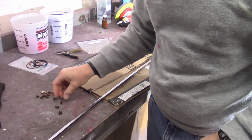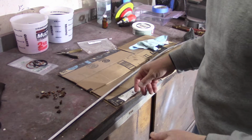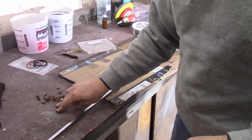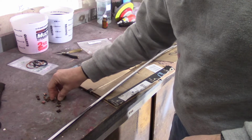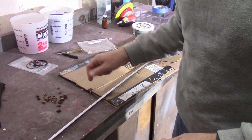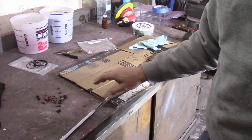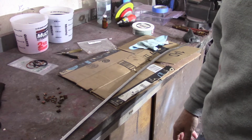You look at the workshop manual, and really all it shows is the big clips. It's just a photograph. It doesn't break down the parts per se. But these all are original, and they came off of Dorothy. So what I'm going to do is put four of the big clips on, essentially at the beginning and the end, and then at two spots throughout the middle, and then the little clips I'm going to intersperse in between there, just to kind of spread them out. And these, you got to hammer it down a little bit, it's a little disconcerting, and it will probably scratch my paint. But I'm going to go ahead and get the clips cleaned up, get the strip cleaned up, and then be over to the car and show you how that goes.